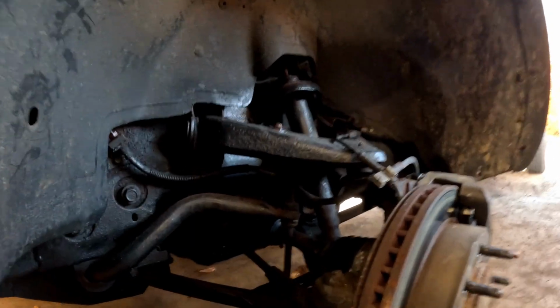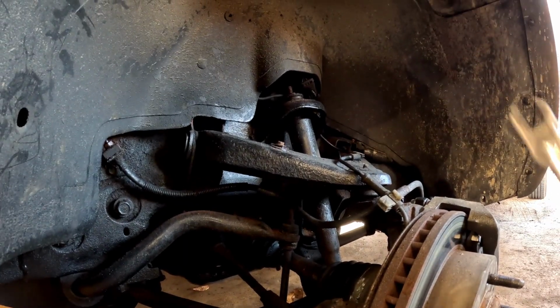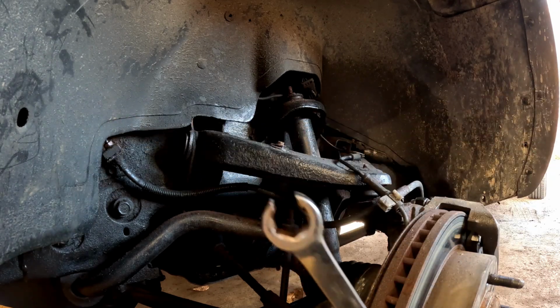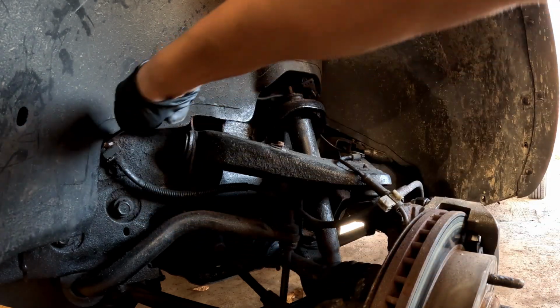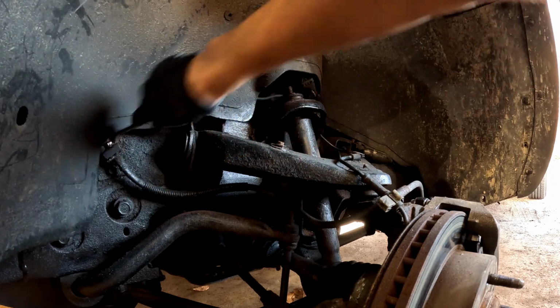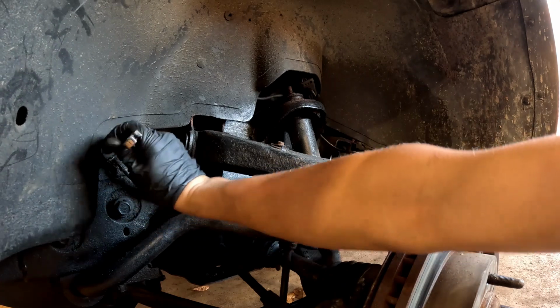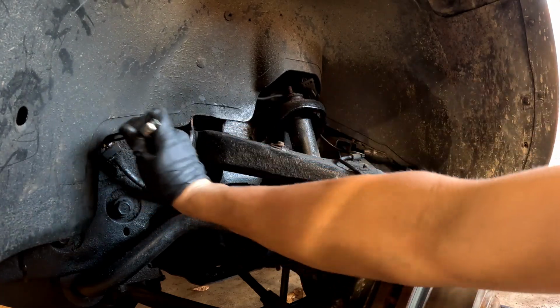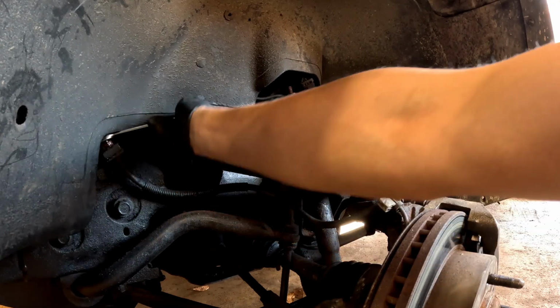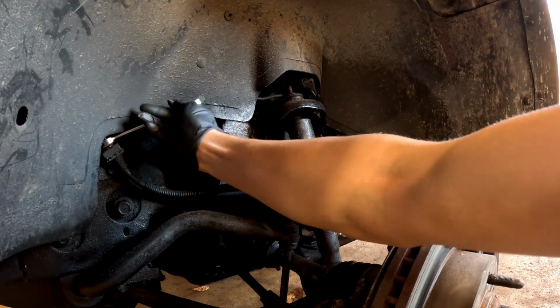And the first thing you want to do is you'll have your line, which is up here. You want to take a 9/16 line wrench and go ahead and break that free. I got mine loose, so I'm going to take mine out all the way right now. And we're going to get this out, if it'll cooperate. Sometimes these are rusted up, so you may have to heat them up. It can be a little bit of a pain.